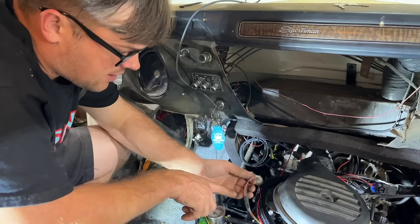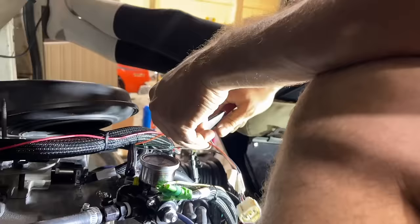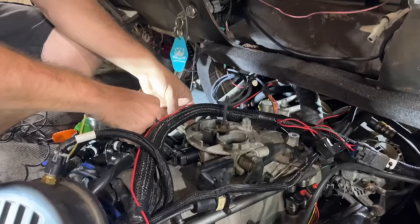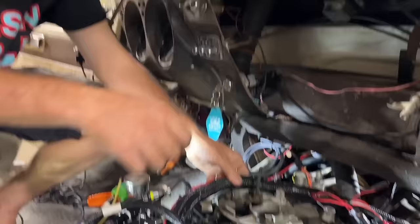So I looked up the pinout, and I believe I have the orange wire and the purple wire mixed up. It's not orange to orange. It's orange to green, I guess. We're going to switch it. You know, I would have thought it was orange to orange. Who knew? Hopefully this is the only wires we got mixed up. Let's try this again. Guys, I can't believe you didn't tell me I had that wrong. How would we have known that? I thought y'all were professional mechanics.